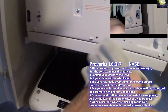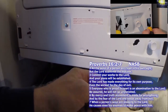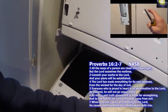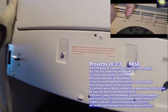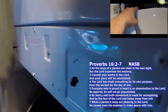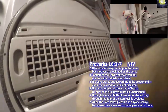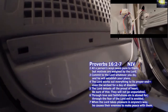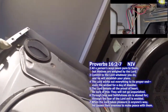It's very sharp. Box of knives. I know, because I've donated blood a few times. Here we go. You see how you can pull the bottom portion forward, and then it's anchored in the top. And then you've got your quick connects up top. You can leave the door switch connected and pull the quick connects.